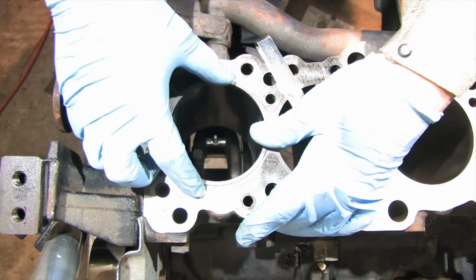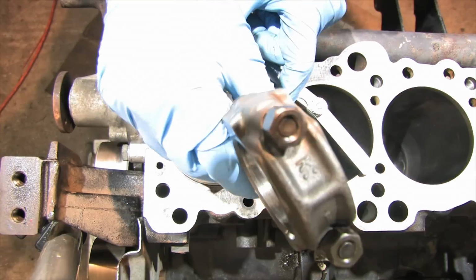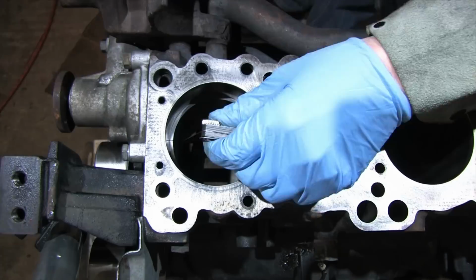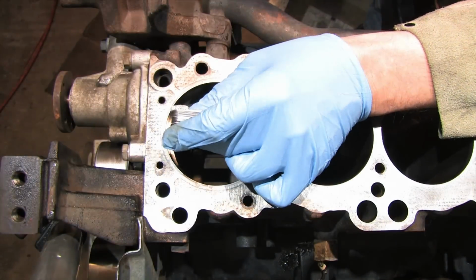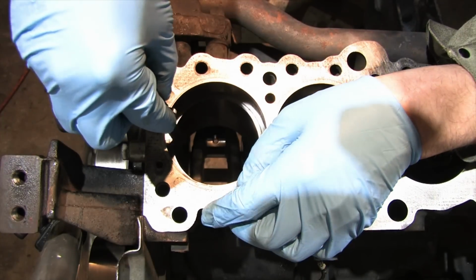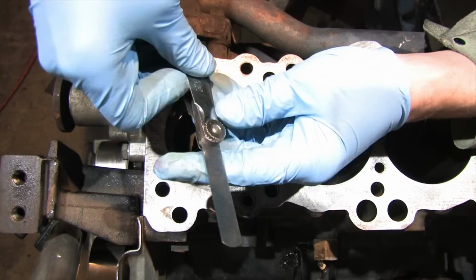The other measurement you need to take is the ring gap. It's a simple process, really. You get a piston, your feeler gauges, the ring, and pay the hole in the block a visit. It's hard to get lights, camera angles, rings, tools, my hands, and my line of sight down in these bores all at the same time, but the process of checking the gap is really easy.